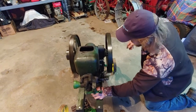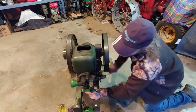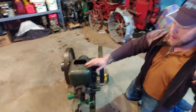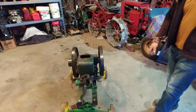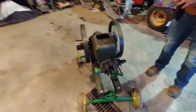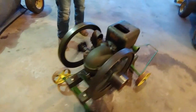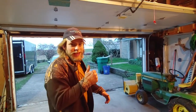And you adjust your mixer until that's a clean exhaust. A little bit of black smoke doesn't hurt — really, they like to run that way. This really applies to all of them except for the six-horsepower engine. Thanks, guys.